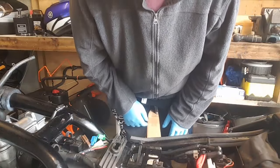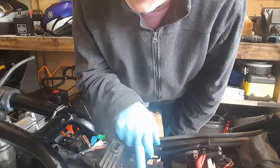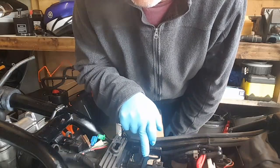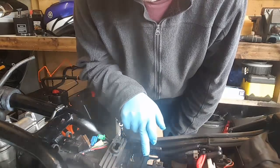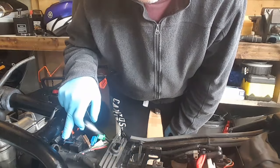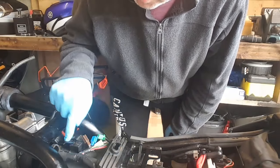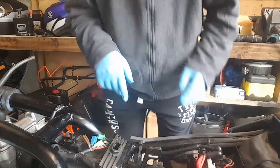Okay, I've set up the tripod, but I don't know if it's, well, you can see half of what I'm doing. I'm going to elongate these holes, so I'm going to center punch these, stick a 3.5mm drill bit through the hole, drill through, and then stick a 6.5mm through it, and then I'll probably have to get the Dremel or some files and elongate the holes.